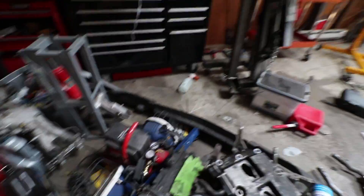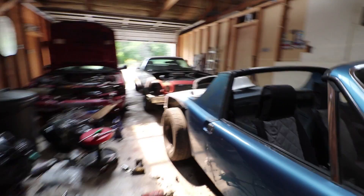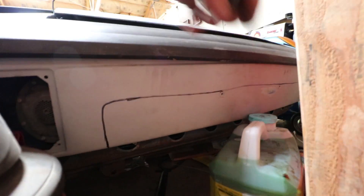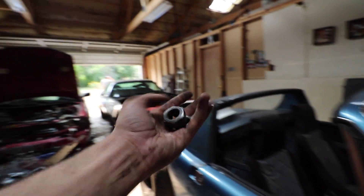I'm going to run to the store today. While I'm here I'll probably be cutting a hole in the front bumper as well as attaching this valence so that there's some airflow to the radiator, because currently it's pretty limited on airflow — there's a couple little holes underneath there but that's all the airflow it's getting. There are big holes I cut underneath here, so when I cut this out there'll be a big opening and it'll get plenty of airflow. I did that in one of the first videos but the bumper has to be cut in order for that to work. So let's head to the hardware store.